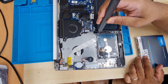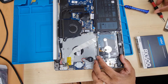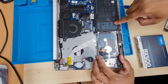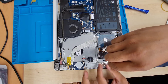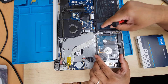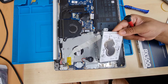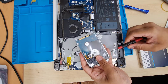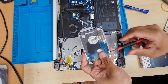Now I'm going to show you how to replace the 2.5-inch SATA hard drive. First, remove it — it's secured with two, three, or four screws. Sometimes a manual screwdriver is better than the automatic one. Don't forget we need the actual caddy from the hard drive. Very carefully open up the flex connector. As you can see, this is a Seagate — we're going to take out the four screws: one, two on one side, and three, four on the other.